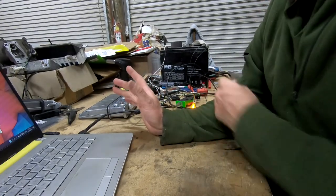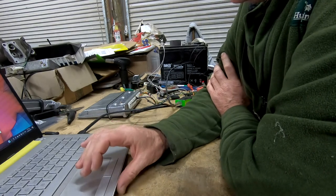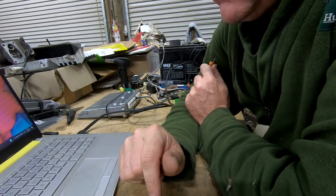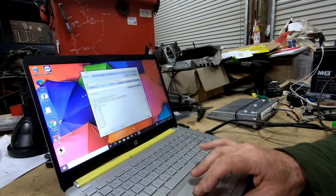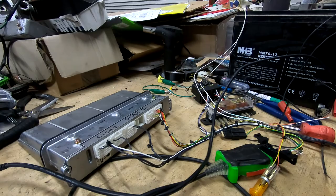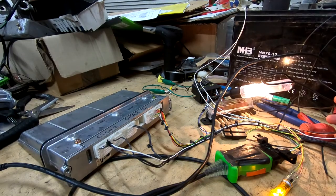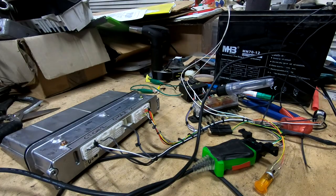This only just turned up today and I rushed right down. We're going to see if we can find some info on it — straight in. This one has the DTC for the immobiliser. We've got 13 codes in there — 13 codes, that is awesome. Let's double check that this one turns on and off properly — yes! Woohoo, it does! That is a big relief. That is a sweetheart of an ECU — nice and clean and tidy.